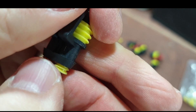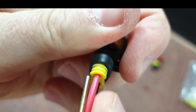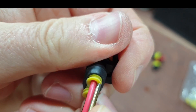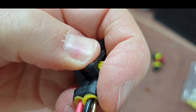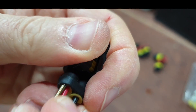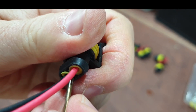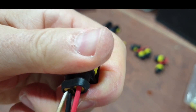Now all we do is take the little grommets, push them up, and what I use is anything to hand - a flat bladed screwdriver. But I find a little drill bit is just as good if not better because it's not sharp - use the blunt end, obviously not the pointy business end. Stick these in and that should stop any moisture getting in and affecting the terminals.